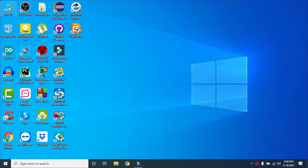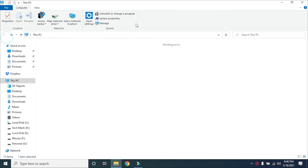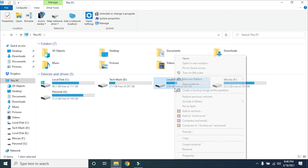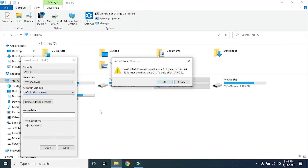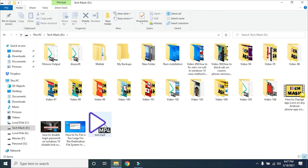Going to This PC, you can see that local disk C is now 111 GB because it is now installed on our SSD. All programs are exactly the same on C drive — we didn't need to install anything. This is our previous C drive on the hard disk, which you can now format. Right-click on the previous C drive, click Format, select default allocation size, click Start, then OK. After the format is complete, you can use that drive however you wish.